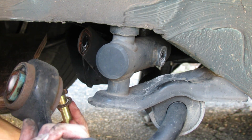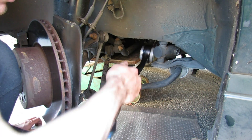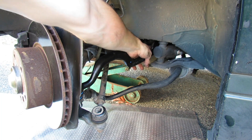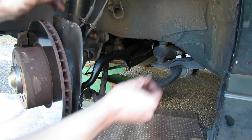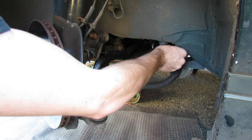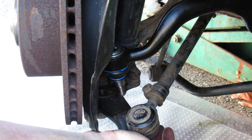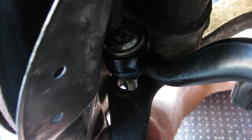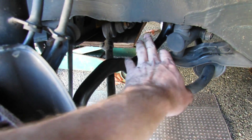Our thrust arm is completely out. For installing the new thrust arm we're going to do everything in reverse, starting with feeding all of this up into here and securing this end with the bolt. There's the bolt, a washer goes between the head of the bolt and the little flange in the car, then the thrust arm, then this chunk, another washer, and finally the nut threads on the end. Back up in here we're just going to get the ball joint back through the hole — to do that I'm going to turn the steering to the left to bring it over.